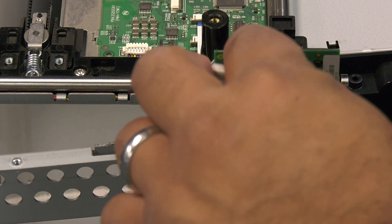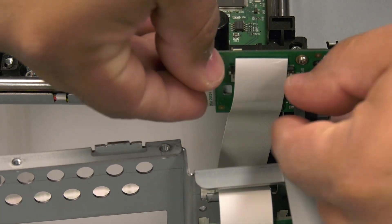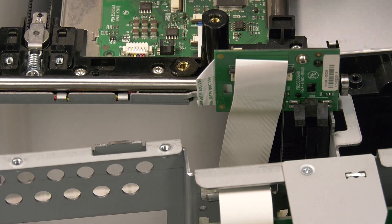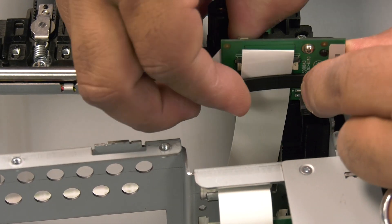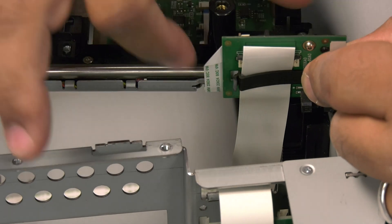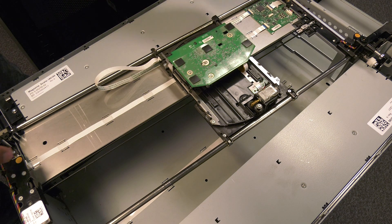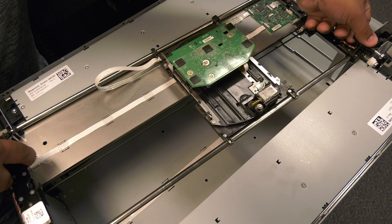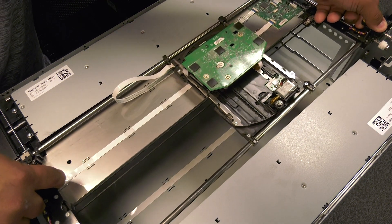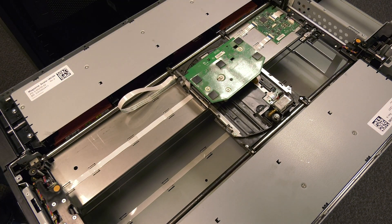Once you have ensured that all four gears are lined up correctly, carefully set the picker on top of the magazines the same way you did when removing the faulty picker. Insert the picker cable into the connector fully and reseat the tension clip locking the cable in place. Now you can lift the picker by the two lift points and carefully get all four gears set into the top of the tracks together. All four gears must be at the top of the tracks together and set fully before you attempt to lower the picker into the library.